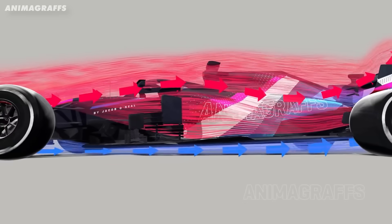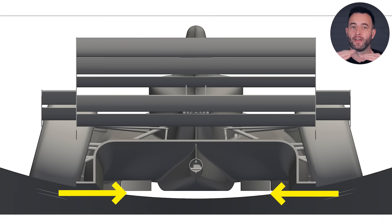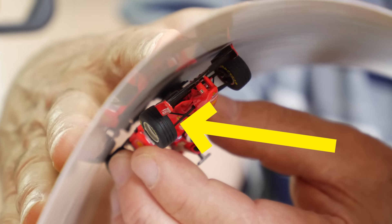It may not look completely conventional but it has to perform. That camber is a bit weird — I'll explain that a bit later. But first: the diffuser. It uses ground effect and it is massive. There is a problem with using the floor for downforce here though. A modern F1 car gets much of its downforce from the floor interacting with a smooth race circuit, but the tunnel's curved floor brings an issue. Because the tunnel is curved below the car, the gap under the diffuser grows significantly — an effective increase in ride height of about 50 millimeters averaged over the entire area.